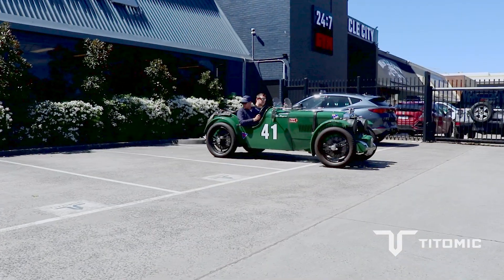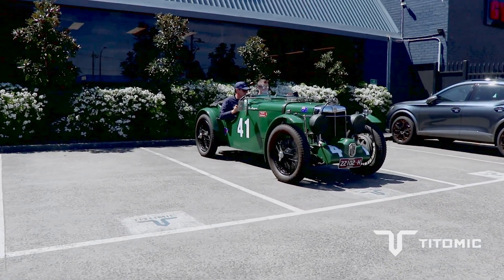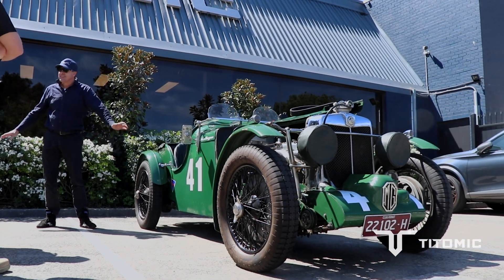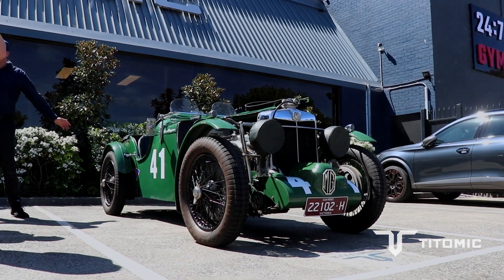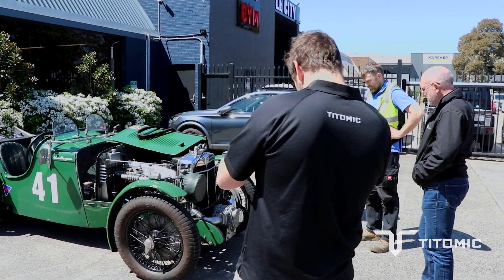It's a bit of a labour of love. Ongoing maintenance is a big part of these old cars. The issue that specifically we needed to address was one of the rear wheels — the rear wheels are held on by a bearing carrier and the hubs bolt onto that bearing carrier. It's 90 years old, so we'll give it some relief, but the bearing carrier had actually worn and the bearing had become loose in that carrier. And this has been the case for over 20 years.